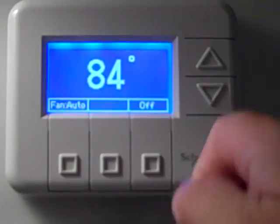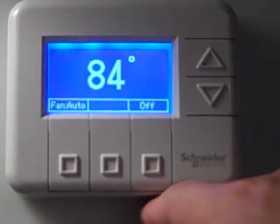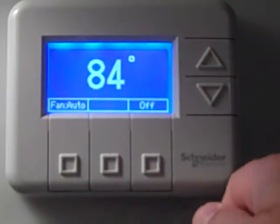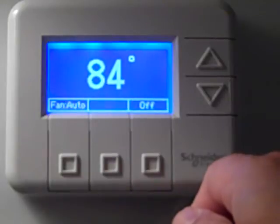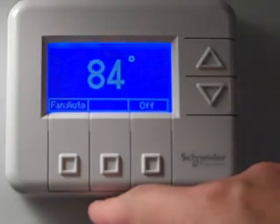What you need to do is take an ambient temperature probe — not a laser shot that would shoot somewhere along the bottom of the wall, as that is not accurate. Take an ambient temperature probe tied to a meter, and make sure that the device you're using is a calibrated device.